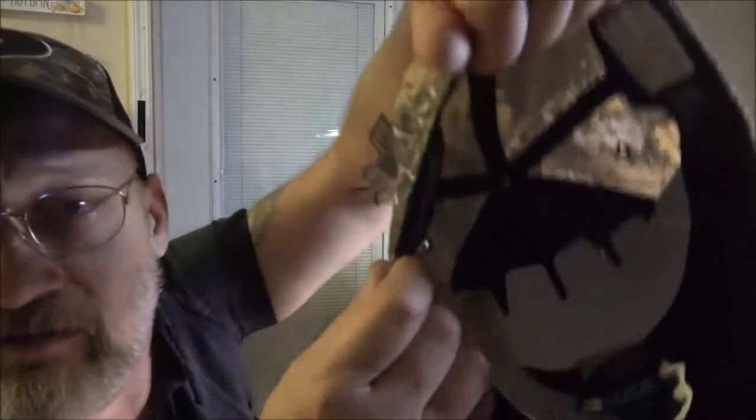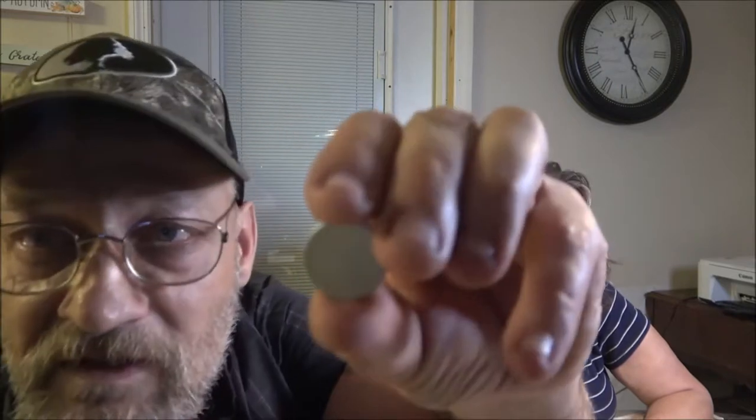Now, the lights are not coming on. So over here on this side, we're going to pull out this little thing. And this is the batteries. I think the batteries are bad. I don't see any sticker to pull off. So what we're going to do is change the batteries. It takes these button cell batteries, a CR2032, just one of these little button cell batteries here.